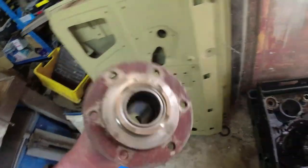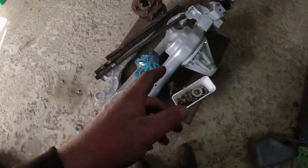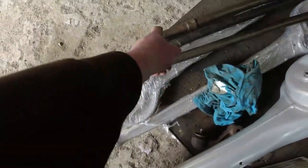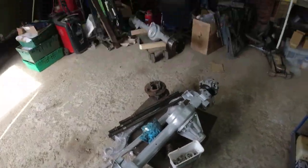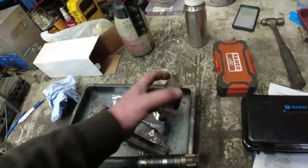There's a nasty mix here of early and late. For instance, on the drive shaft front, I found a pair of drive shafts suitable for the front axle, but that one is for an early axle, non-ABS. I don't know what these two are for — they may be back axle, because there was a short period where the back axle had drive plates like the front axle. But I haven't got drive plates, so I can't prove it.